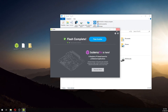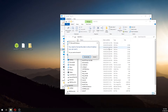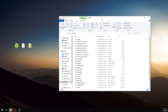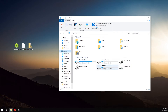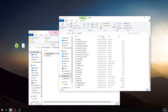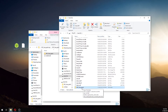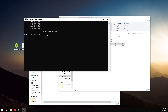After it's done, close Etcher and unplug and reconnect your SD card to your computer. You may see a window pop up asking you to format — just ignore it and close the window. Next, we want to copy the GPI case patch to our newly flashed SD card. Open a window at the root directory of the SD card, which should now be called 'boot'. Open up the GPI case patch zip file, double-click the folder called 'GPi_case_patch', and copy the folder called 'GPi_case_patch' inside there. Head back over to your boot window and paste the file there. Then open up the folder and double-click 'install_patch.bat'. You should see a black window pop up and copy some files over. Once that's done, press any key to finish the installation.